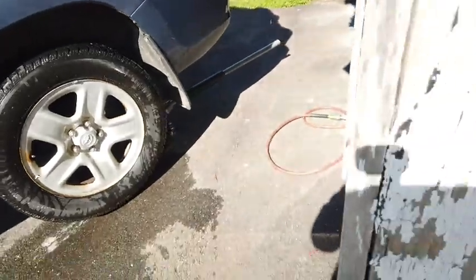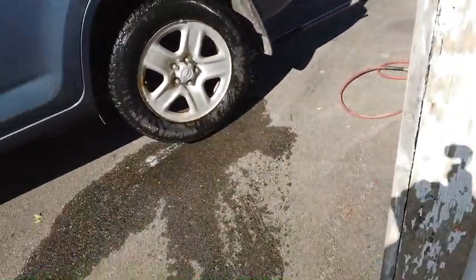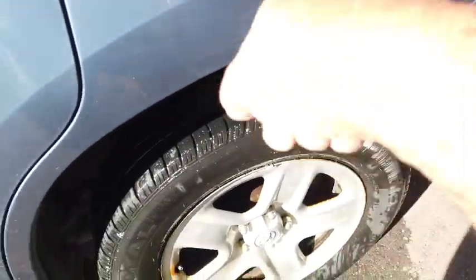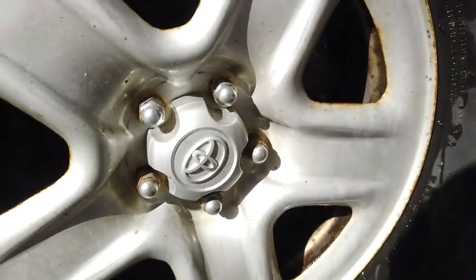This is easily fixable, except that somebody got sued for fixing the tire the way I'm about to fix this one a few decades ago. Tire people and gas stations and everybody that used to fix tires all the time for people stopped doing it this way. The fix is basically to punch out that hole, take a tool, widen it out, take a little piece of cord soaked in a tar-like material, and poke that cord into the tire and pull your tool out. The cord stays stuck in the hole and the tire won't leak anymore.